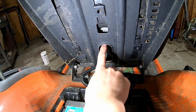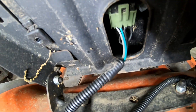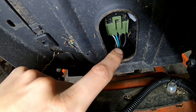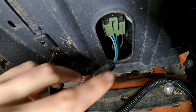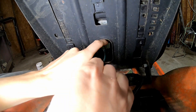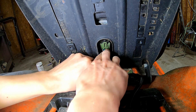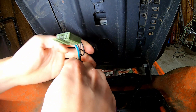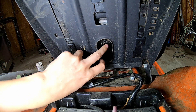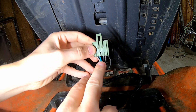What you have here under the seat is a pressure switch, and there's a connector attached to it. Inside of here is a small tab or tang that you have to pull out and push down on to remove the connector. There's the connector — you can see the switch itself in here. It has four prongs on it, so we have four wires on this switch.